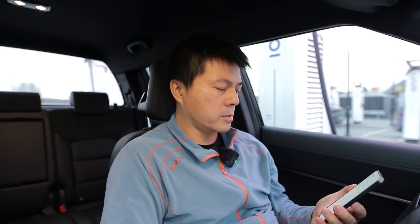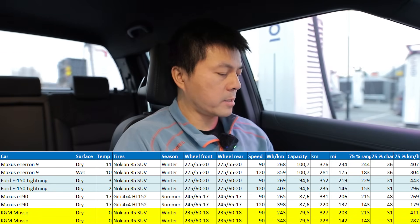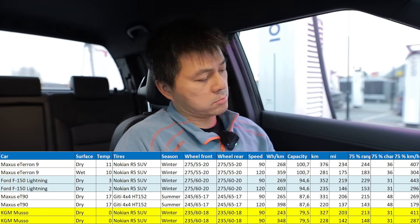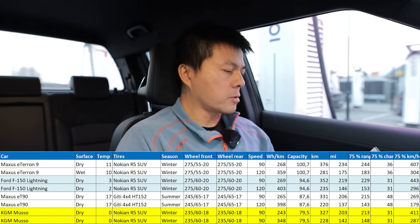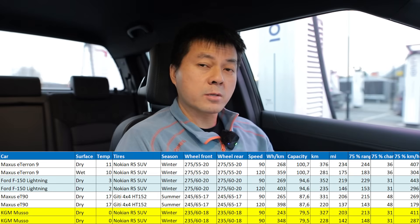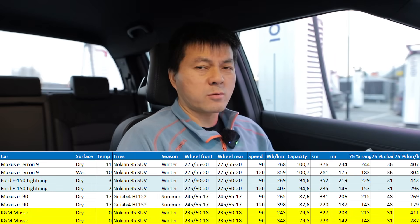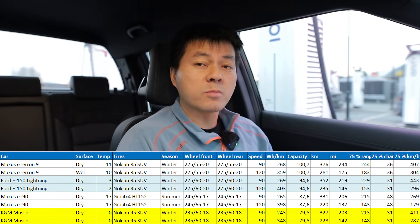According to the numbers, if we use the 11.1 kilowatt-hour remaining, we get 79.5 kilowatt-hour net capacity. According to spec it's 81, so we have slightly less than spec. Based on the consumption corrected for 3% under-reporting, we don't get that great range — but remember it's cold outside, so at 10 or 20 degrees it's going to be better.